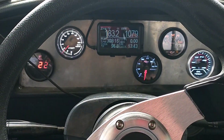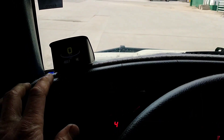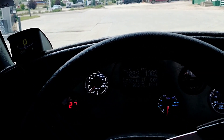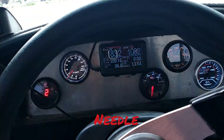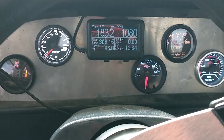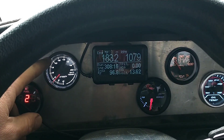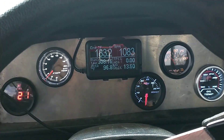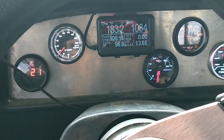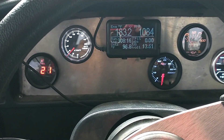Let's go for a drive. Just a quick overview of the dash — there's a lot to look at. I moved the speedometer up here so you can see it. It's not as impressive seeing acceleration digital, you don't really get to feel the dial moving, but it is fun to watch the boost. You can pretty well see everything here. It runs about a thousand degrees when I'm accelerating, and if I really get on it, it'll get up to 1200 or 1400. Boost is set at about 36 pounds, which pretty well pegs the gauge out.